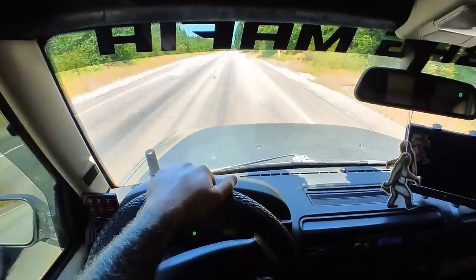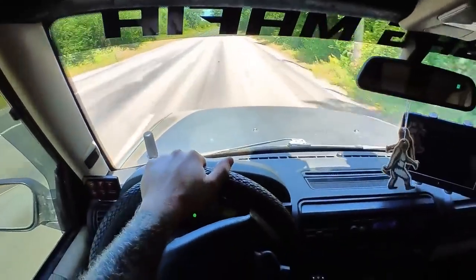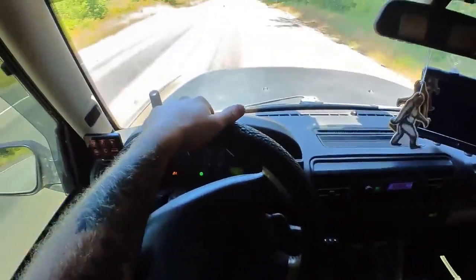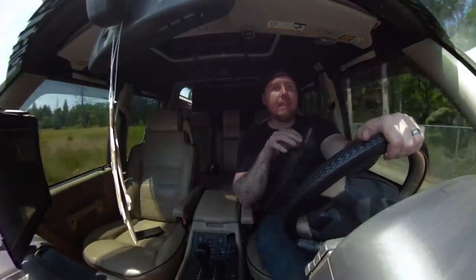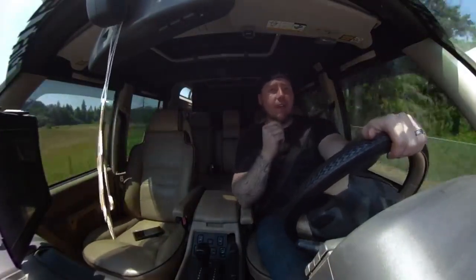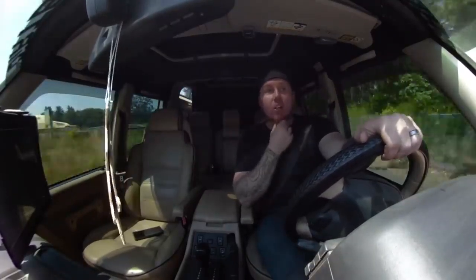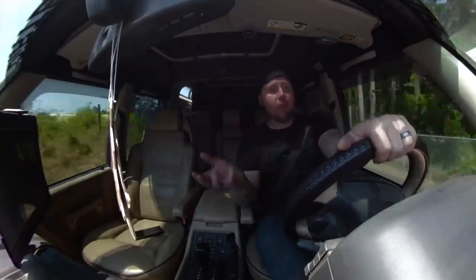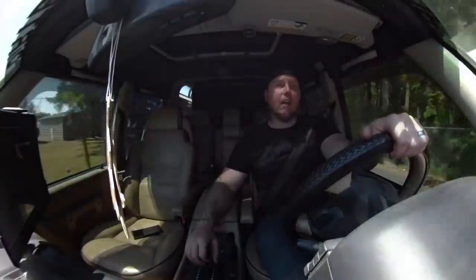Do I have lights? That's going to be one that people are going to ask. I do have lights now. My first drive around the block, no lights. It seemed like I wasn't tripping the ABS system. Because if you remember, whenever I did this one ton swap, I put a lot of work into making these sensors work, and it looked like they did initially, but now I've got a light, or got a code. So what I need to do is hook up a scan tool and see what corner I'm having an issue, and then I can troubleshoot from there. Hopefully it's as simple as a bad sensor, or maybe a chunk of metal stuck in this. Who knows until I can scan it.